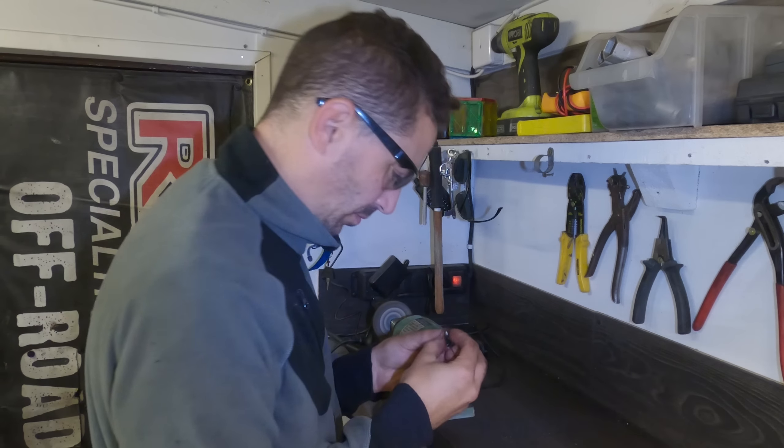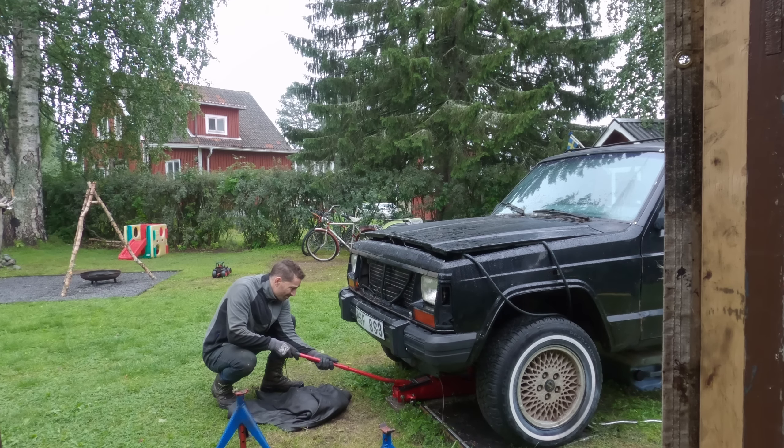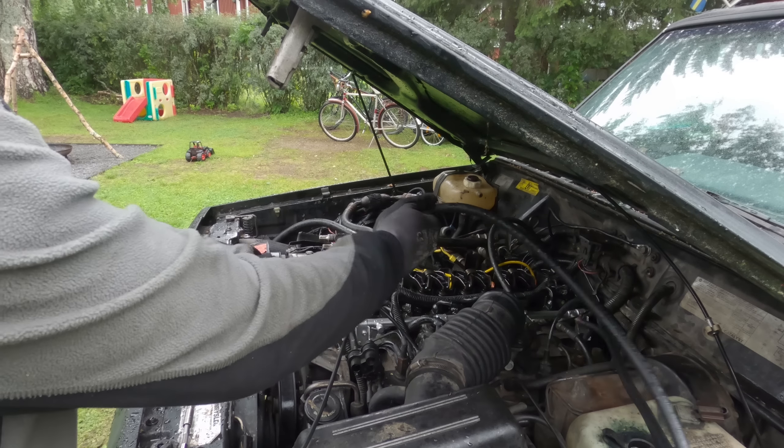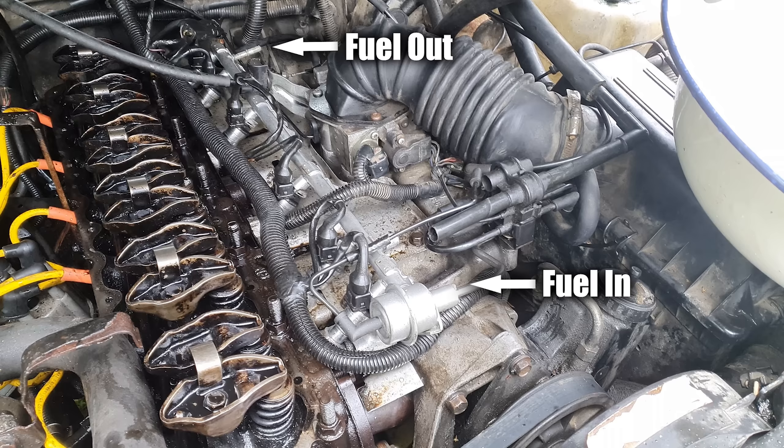Well, I replaced her anyway. This one here was extremely loose and it was out by probably a couple of mil, so I'm assuming that might be one problem — maybe there's multiples. So I'm going to get this out, clean it up, put some Loctite on it and put it back in. This is definitely a job that's easier with two, unless you have a device to hold the flex plate so you can tighten the bolts. Megan is holding the harmonic balancer bolt for me so I can make sure I get these bolts tight. All four bolts on this flex plate were completely loose. I've also tried to make the flex plate move and creak as I've rotated it, and it doesn't appear to be doing anything — which is a good sign, meaning I don't think it's cracked yet.